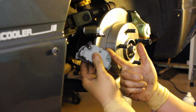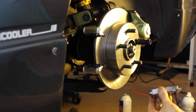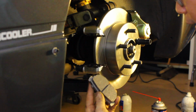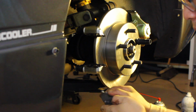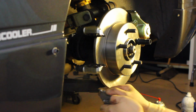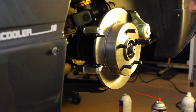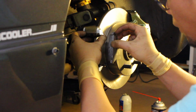So before you put on your brake pads, you want to make sure you get the right orientation. So I believe the indicator goes on top. Yeah. Alright. So the brake wear indicator, I normally like it on top here, so I'll be putting it in like that. And then obviously you also have your front pad. Out of the box, you want to give it a good rub down like this, just to get the surfaces ready to go. I know it's going to create some dust, but boom. Alright, so basically you just install them right here and you're good.